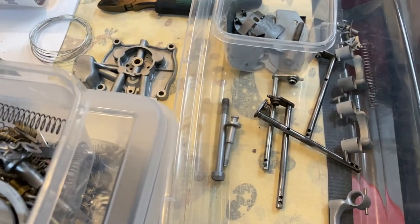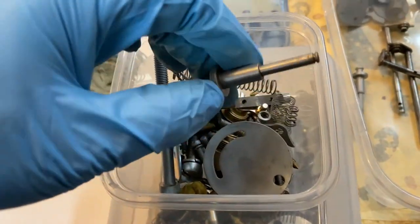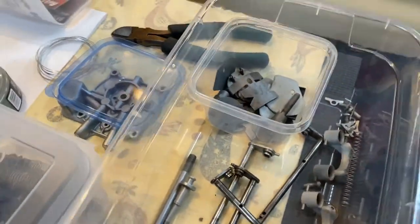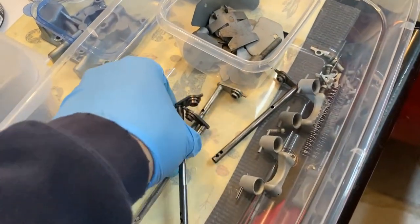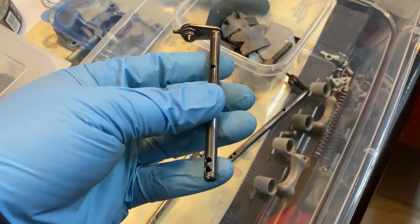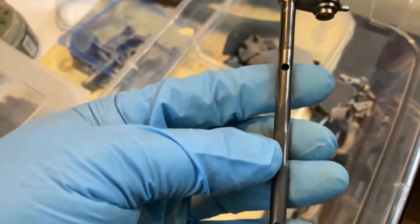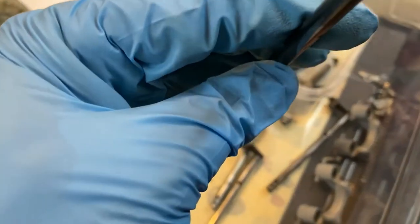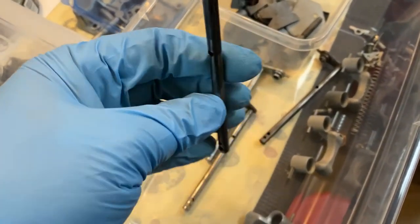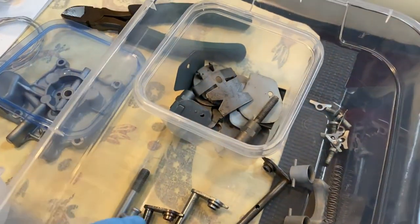You can tell when you look at these parts that are very clean — they have been blasted in the glass bead blast cabinet, and boy it makes them very nice. Of course not everything can or should be blasted. I don't blast the bases. I don't blast these rods for the accelerator pump — if you know anything about these, they're vented, meaning they're hollow, and there's no way to really clean that out all the way through. So I don't blast these; I clean them up with a wire wheel. But most of the small parts you can blast and clean up.